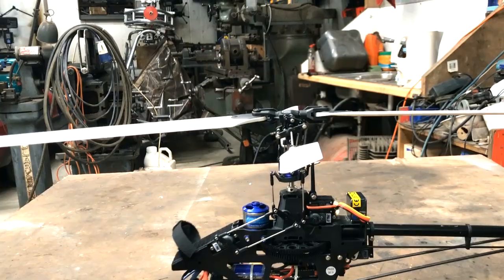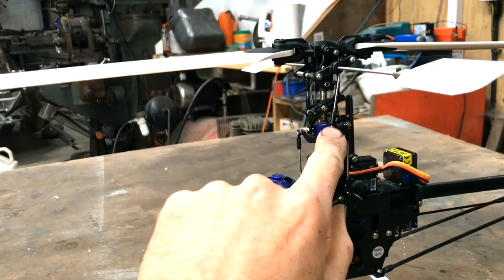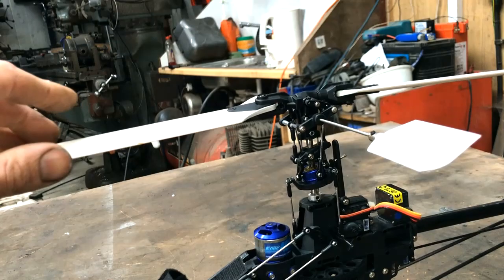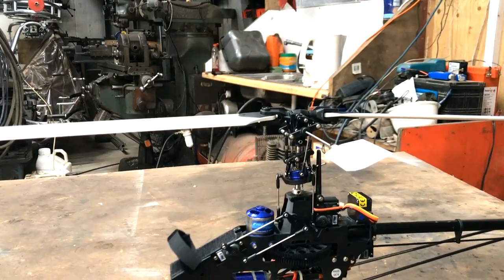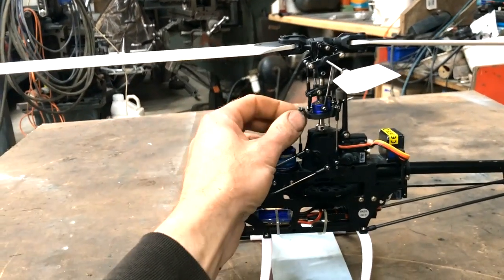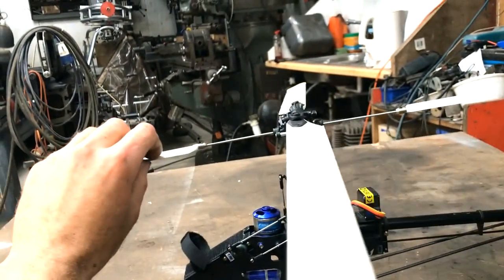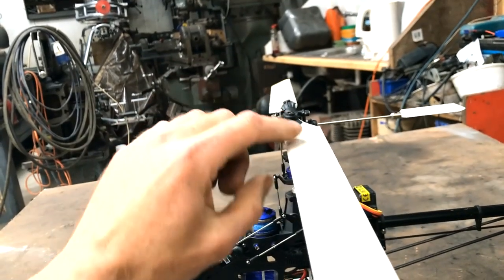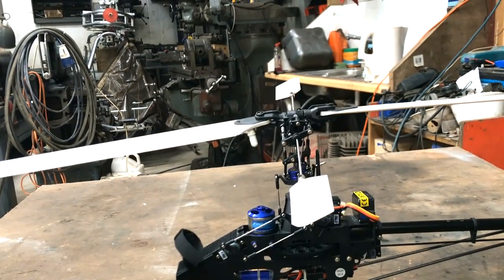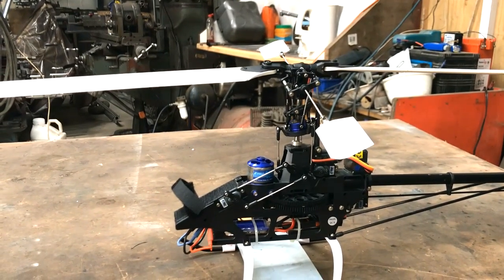So what are the advantages of this system? Well, without the fly bar, the pitch links on the swashplate would be directly connected to the blade grips on the main rotor. This would give an approximate 90 degrees phase lag. With the addition of the fly bar, the phase lag is more like 180 degrees. To recap: swashplate tilts forward, alters the pitch of the fly bar. 90 degrees later, the fly bar has tilted forward. That's altered the pitch on the main blades. Add another 90 degrees, and the main rotor has tilted forward. This has increased the time it takes for the rotor to react to the cyclic stick command, or phase lag.